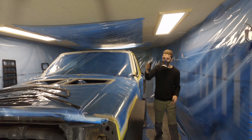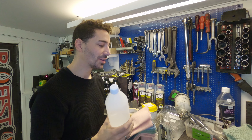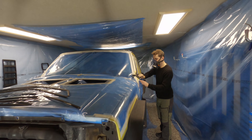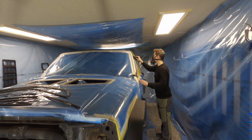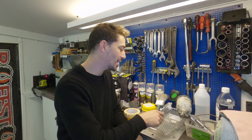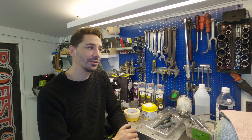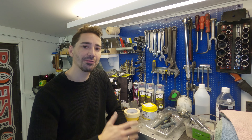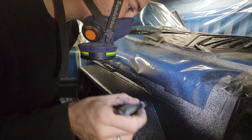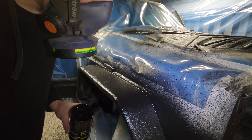The most important thing really is clean rags, panel wipe, and paint thinner. Things like that really help in this process, especially having lots of clean rags. The last thing you want is getting dirt back into panels and pits on the paint. Another thing I'd say is brushes. Raptor liner has a nasty habit of pinholing — you might put it over a surface and not be fully aware of its coverage because it's so aggressive you can't see pinholes. Then rust starts to come through years or months down the line, depending on your climate. It's happened to me, it's happened to other people.